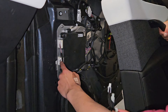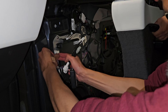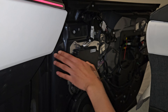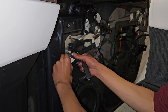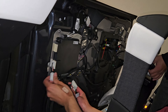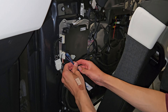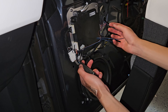Have a friend come grab the door and hold it — you don't need to take the entire door off, which means you don't need to unplug anything. Just have someone hold the door right here. From there, unplug the top part on the passenger side door — push the little clip in and wiggle it out. Your puddle light will turn off and the door will think it's closed. Make sure the window is all the way down. Take the splitter, split that connection — it only goes in one way, make sure it locks.